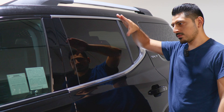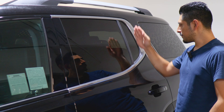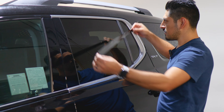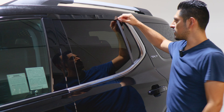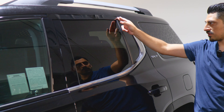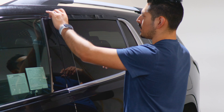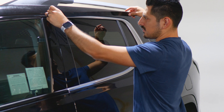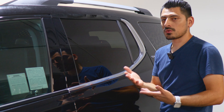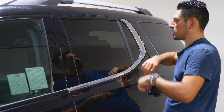When you finish with the front section and start on the rear panel, you'll notice the chrome panel has two cutouts — one here and one here. There are different ways to go about the installation. You can start by aligning the film right on the edge of where the cutout is located — that's perfectly fine. If you do that, just start here, work your way over there, and trim off the excess material. But if you do it the other way, where you start on the other side, same process — just align it there, work your way, and trim off the excess material where the cutout is located. There's no correct way to go about it; just make sure wherever you start it's aligned and trim afterwards.